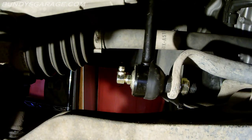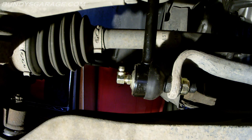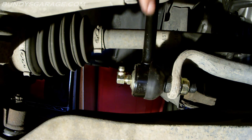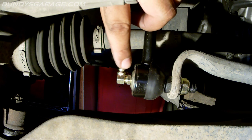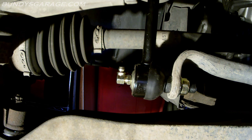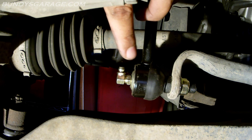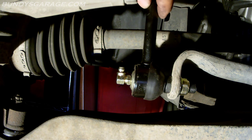One thing I wanted to point out is that when you put the zerk fittings in, you want to face them basically down or leaning towards the other end. That way it's easier when you need to grease these in the future, because if this was 180 degrees down it'd be at the lower control arm and just make it that much more difficult to get to. So I put the one on top facing down and the one on the bottom facing up. Just make sure you put these in a position that makes it easy to grease when it comes time to do that.